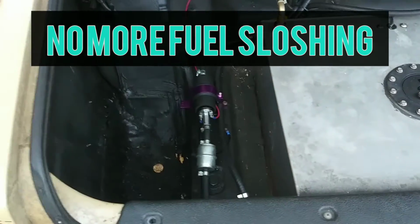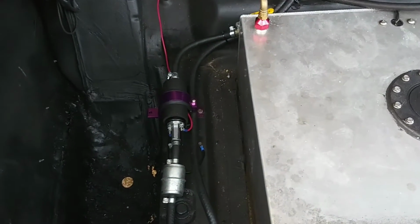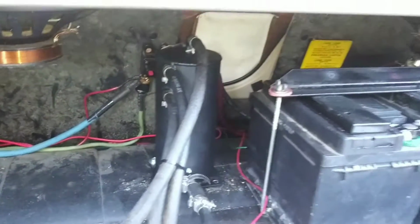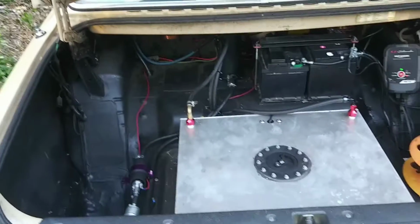And I had it set. I have an adjustable fuel pressure regulator. I set the fuel pressure somewhere around 35. I added a swirl pot, a relay for a fan, but the relay triggers both my fuel pumps. I have a pump now that picks up to the swirl pot, and one goes from the swirl pot to the rail. Now, when I did all that, I shortened the wires, and like I said, I used a relay and a ground trigger for a relay, with like a 60 amp fuse. So they are running way more powerful.